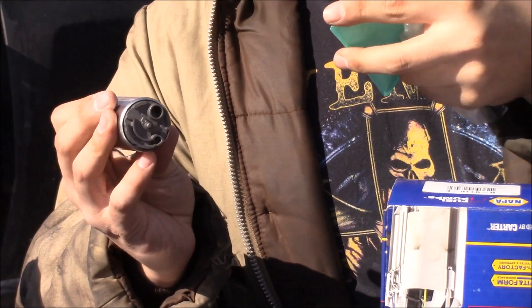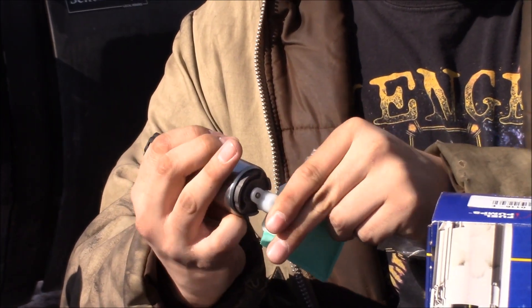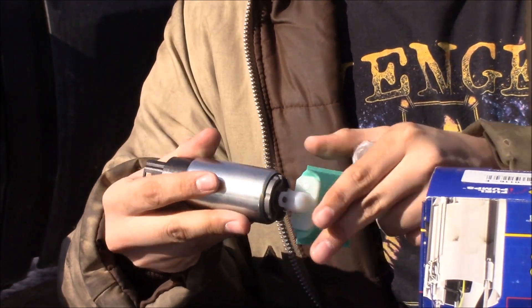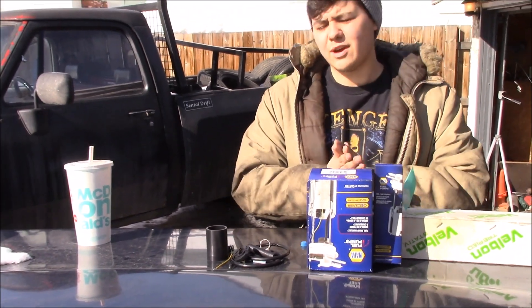The way the sock goes on the fuel pump — there's a little cap, take that off, and she just slides right in. Nothing too big, nothing too hard so far. Let's go drop the fuel tank and see what's next.